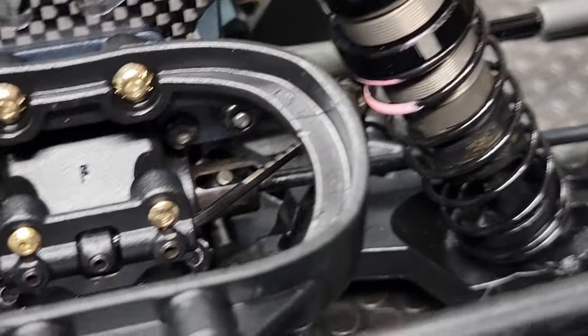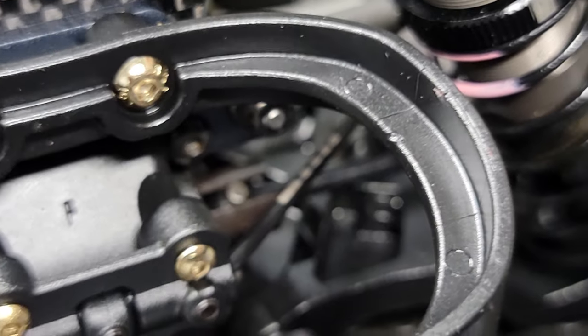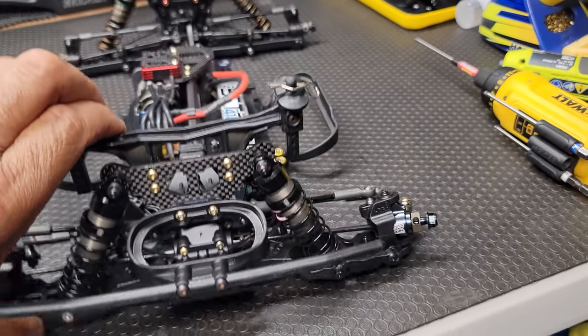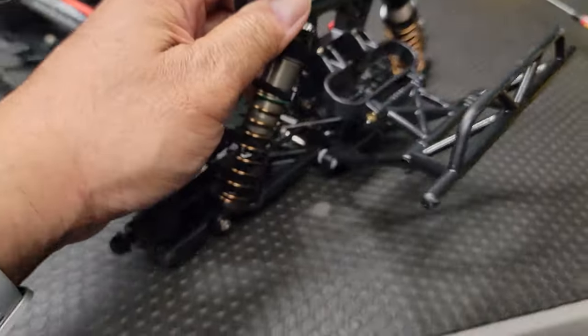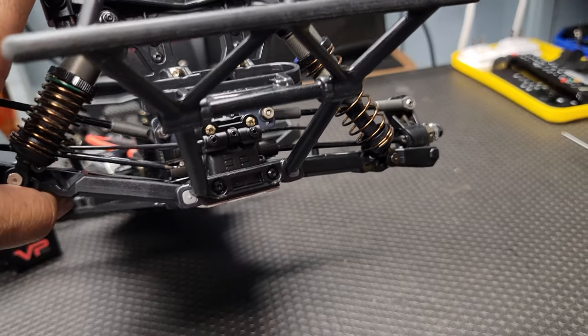As you can see here on the front, I have the heaviest sway bar that they make for this car. Just so you know, all of them have that one large line and then the 4 dots after it. And when I lift the arm, you can actually see the other side lifting, much like in an 8-scale buggy. And I noticed with a very light sway bar, it barely moves anything. The rear does not really move, just slightly at the very end of compression there.